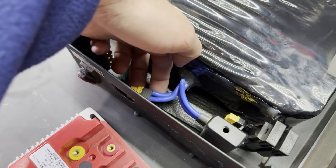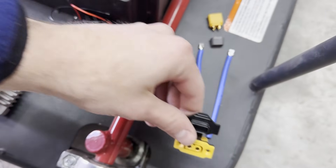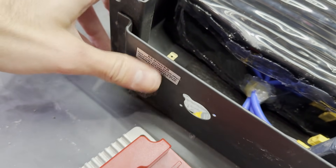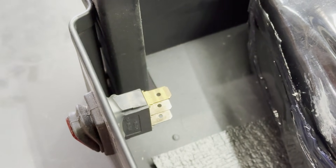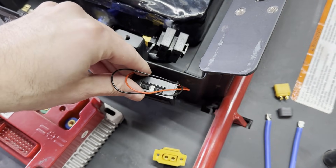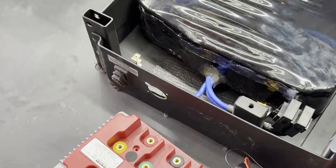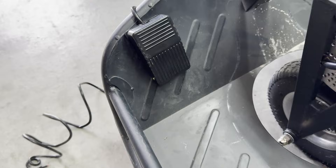To charge the battery, I'll take the extra XT60 plug and connect it to an XT60 extension using a panel-mount XT60. I should be able to use the stock power switch, which will be pretty convenient. It's got three connections in the back, so I'll use my multimeter to figure out which is which, and I'll see if I can add a resistor so it doesn't burn out the light at 72 volts. I'll also install a voltmeter upside down so it's easier to read from the seat. After that, I'll add a three-speed switch, wire in the stock throttle, and add a brake pedal — though it's more of a regen button since it's just on and off.